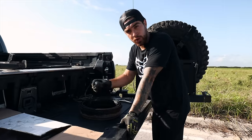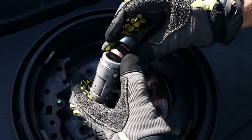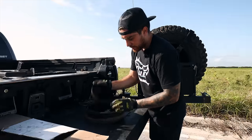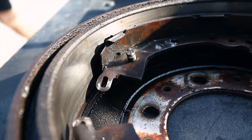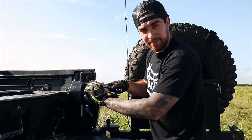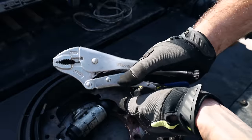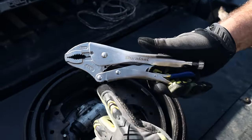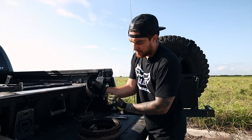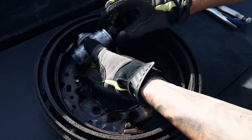We have the brake wheel cylinder here. If I pull this back and pull it out, you can see the seal broke right there — that's essentially why we had the leak. This part also bent. What I believe happened: you're applying your brakes, it eventually reaches the braking point where you can no longer keep going, your brake fluid has been maxed out, it cannot compress anymore. I continue to press the brakes — think of having a hydraulic press. Eventually one of these components is going to give out. First gave out at the bottom, completely bent, then all the pressure went up to the top wheel brake cylinder and the seal broke.